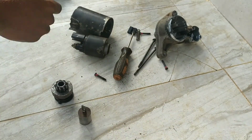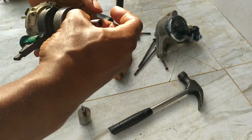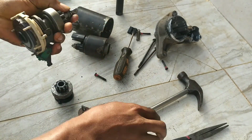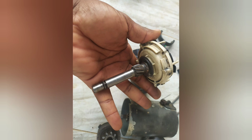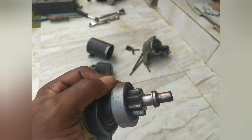Basically, the difficult part is getting the circlip onto the groove on the shaft and then putting the shell around it to lock it in place, using a plier here to reduce the diameter. So here's showing a close-up of where the circlip and the shell is to fit onto. I ended up using a plier to reduce the diameter of the circlip and then slid on the shell and then put the circlip into the groove, and then eventually using a 13mm box end wrench tapped the shell to lock it in place. So I have it all installed right here. Here's another view of that, and then assembly continued.